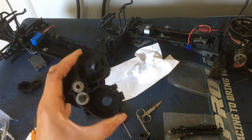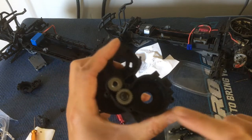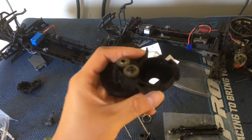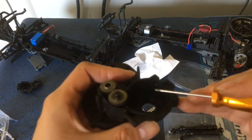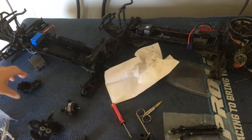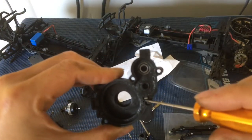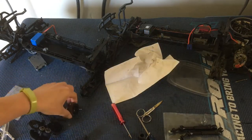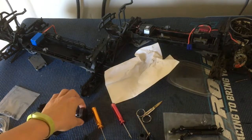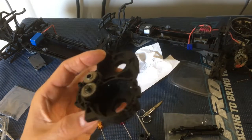So that saved us some money there, but upon opening up this gearbox, we noticed some metal fragments. Let me point this out here with the driver. It might be a little bit hard to see with the lighting on the camera, but there are some fragments in there. If I take the other side of the case here, you will see some over here as well, right? There's a pretty large one. Now, examining the gears, nothing seems to be chipped or broken, so maybe it was the previous gear set that was in there that the owner had swapped out or whatnot.